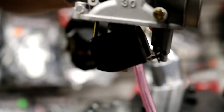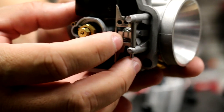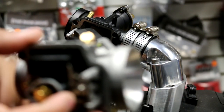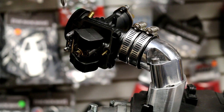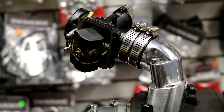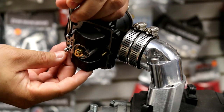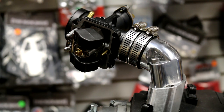You're just going to push on this little tab right here with a screwdriver. Now say you have just the opposite, where you need more fuel because at top end you're running out of fuel. What you would actually do is take this and bend that tab down. Usually a little flat tip screwdriver, you can stick in there and kind of pry it. If you needed more fuel at top end, you would take a flat tip screwdriver, hold this at the same time, and pry it. This is probably going to take one, two, three, four times of adjustment to get it perfect, because you're not going to want fuel starvation at top end, and at the low end you're not going to want overflow.